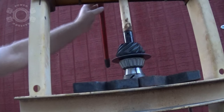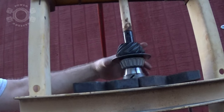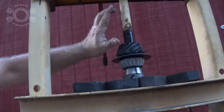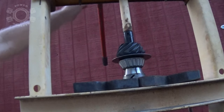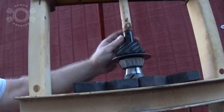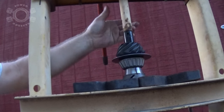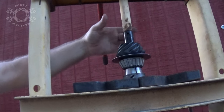I'm going to pause here for a moment just for a tip. I'm using this little small socket like this, and if I felt this bearing was going very, very hard and I was putting a lot of pressure on it, I would take this out. Because it's not very big diameter, and the shaft - the arbor - wants to kick one way or another, the socket will be a projectile. So you take your choice - whether you want to do something like this, or if I had another set of plates I would stack them to get a little bit more. But you're using a lot of pressure here, so just be safe about it.